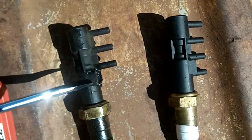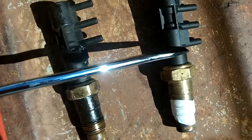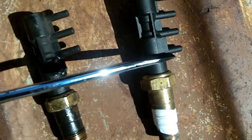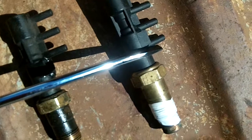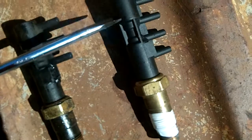I needed that. I'm doing a workaround — it used to have two thermal vacuum switches, and I'll have to pull vacuum from this switch port to this switch port. Those will both be ported vacuum.